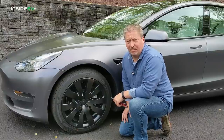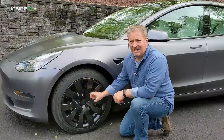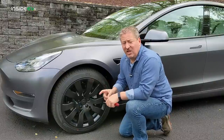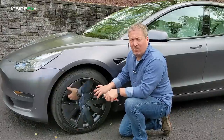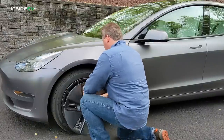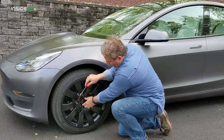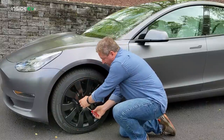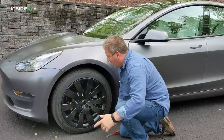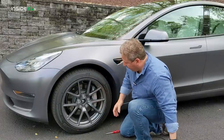Removing the orbital wheel covers is simple, but you do need a screwdriver, because the center cap has to be removed first. You can't pull the wheel cover off in one piece like you can with the original equipment aero covers that come with the Model 3 — those you can just pull right off. With these, you need to remove the center cap first. Be careful not to scratch the wheel; work it around a little and you can get your hand on it and pop it off, then the wheel cover just pops off simply to reveal the wheel.